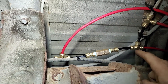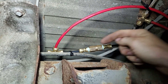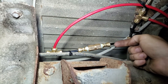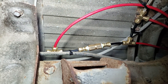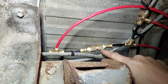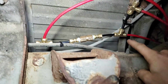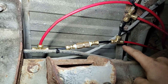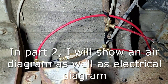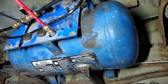When I hit my dump valve switch in the truck, air is pressured up on this side because all the air is going through the valve and the dump switch. The air evacuates out this way, allowing the air to dump out of the bags through the one-way check valve. Without that valve, you'd have full pressure going to your airbags and the auto level valve would not work at all. So you have to have that check valve there. I'll show you on paper what it looks like — I drew out a diagram because I know this is hard to follow visually.